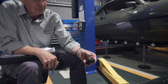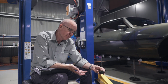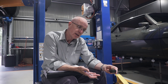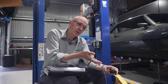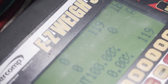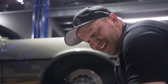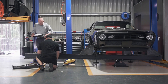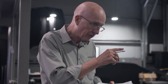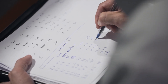We've got these very hard, high durometer rubber body mounts between the chassis and the body. As the torque comes on, the chassis will take load, gradually compress those slightly, and then start applying some load to the body. It will be interesting to see how that comes up in the results. Let's wind some load on. I really need the sum of the two movements, but I've seen a lot more twist in vehicles before — let's put it that way.